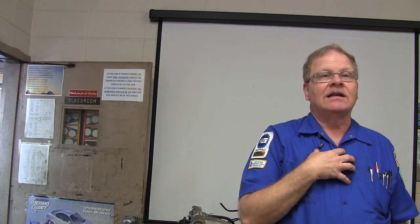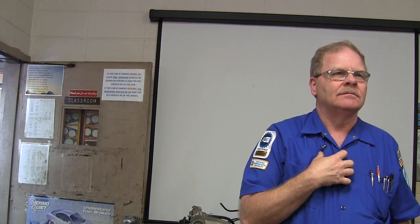What's the most common thing that you think might be wrong with it? Huh? No voltage. Well, it depends on the vehicle. Some of the ABS sensors have to have voltage fed to them. Like on that Dodge Caravan, it's got to have 12 volts fed to it and the ground, and it puts out a square wave signal. You know, it switches between 7 and 14 milliamps as the wheel rolls. It's difficult to read that too, huh?